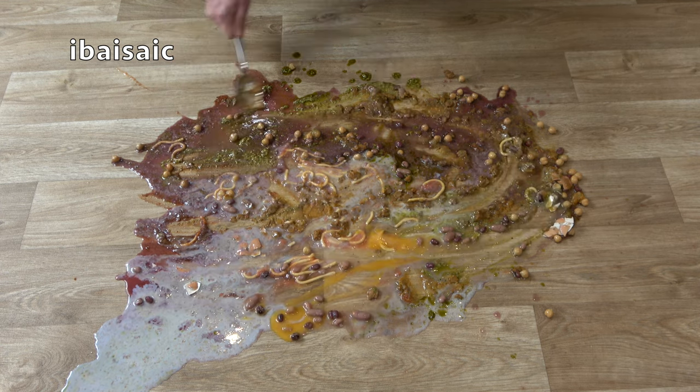So yes, there is some cleanup involved, but on a day-to-day basis, if you're just using this on a floor that looks fairly clean, as I showed you at the start of the demo, the maintenance isn't so bad. It's basically just tip the water out, rinse out the tank, run the self-clean cycle, and occasionally wash the filter and manually wash the roller.